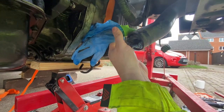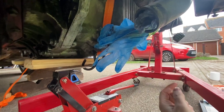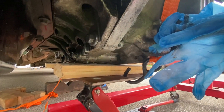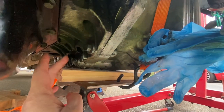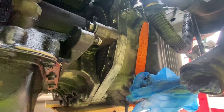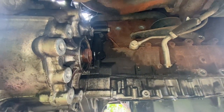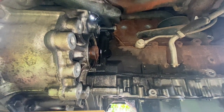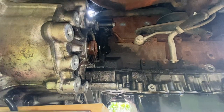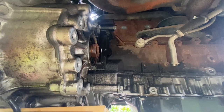With the two oil feeder pipes removed and covered with some gloves to prevent contamination, we've got four bolts underneath - one at the back, one in the middle, one here, and one just below the starter motor housing - and then two more at the back. The other two bolts to remove are on the back of the engine block, one at the top and one at the bottom. I've left one of the bolts on the far side finger-tight just on the safe side.